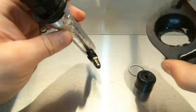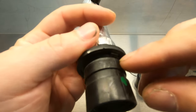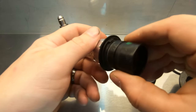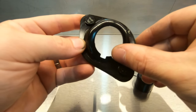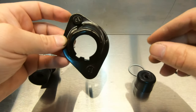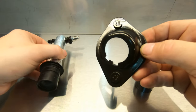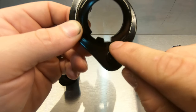So snap ring's off, and I'm looking at it. There's a little piece of keystock, if you will — a little molded keystock piece molded in to prevent this thing from rotating in the bore of the mount. And you can see — imagine this one not being here, that's how it's indexed as it comes. So I put it back together without the snap ring, just kind of sitting out, stuck it up against the firewall and rotated it to where I liked it. I made a little mark with a Sharpie where the piece of keystock was sitting. And I took a Dremel and matched that one as best I could to put a second keyway in it. Then I just put it back together, except in the new keyway.